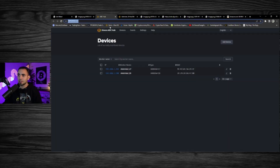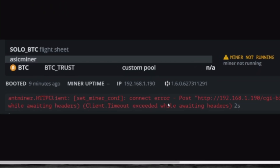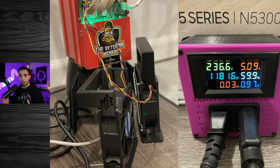This right here — AntMiner S9, MIL7 — are both through the ASIC hub. Over here you can see HiveOS, AntMiner S9 is up and mining, all registering through this, which is amazing. This is what I did see through HiveOS originally, and it was terrifying because I had never seen anything like this. It said: 'timeout exceeded while awaiting headers.' I assume the headers are the fans — I don't know, I could be wrong. Either way, that's what ended up fixing the problem — plugging the fans back in. So right now I currently have the fans plugged in outside this unit.